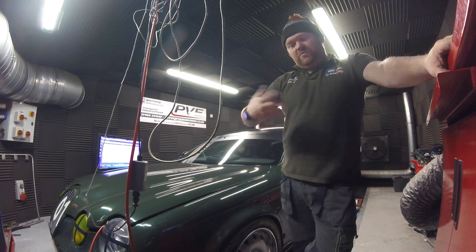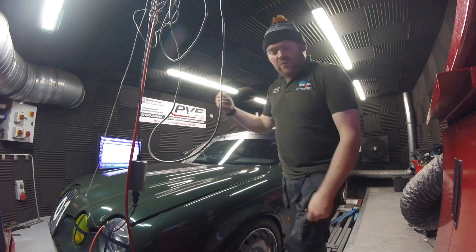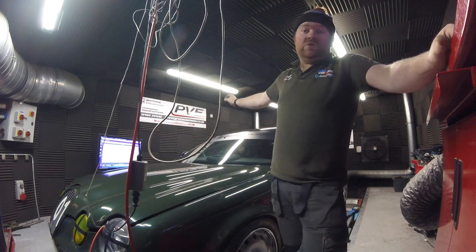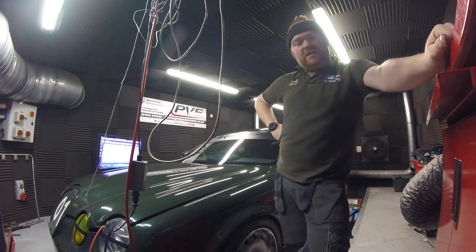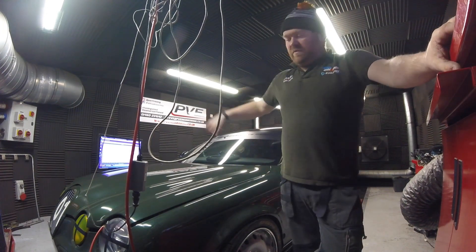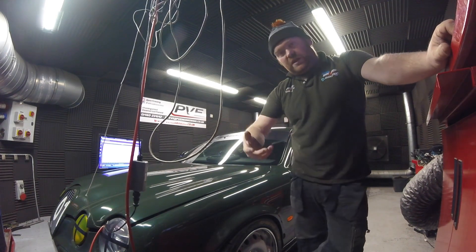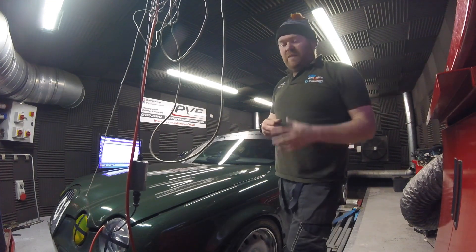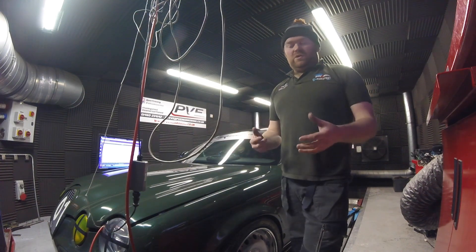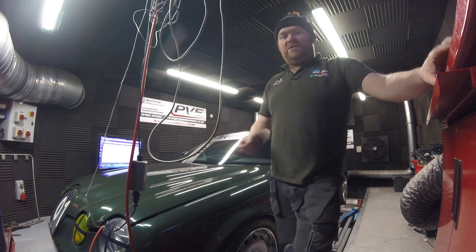Fast forward to today — we've now got this fully running car. All the fuel pumps are integrated within the ECU, powered as they should be. There are two fuel pumps on the car: one from a fuel pump control module, one from the rear body control module. The instrument cluster is now working correctly. Today I've picked up on some brake pressure and we've found all the wheel speed sensors in the CAN bus. So we've now started to integrate traction control and launch control — all of these things which the Max ECU can do natively. Also, for this sort of car we want to use cruise control, and yes, we've got cruise control working via the actual steering wheel buttons as it should be, just like a standard car.